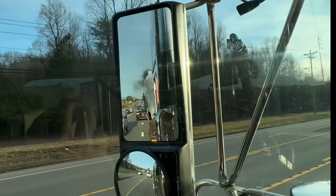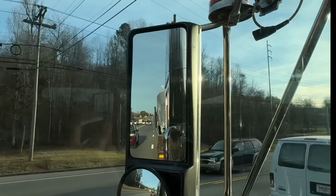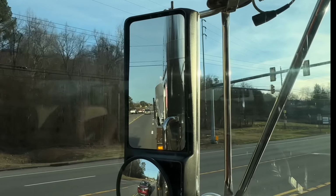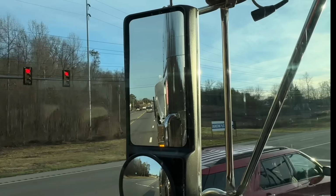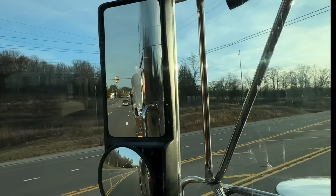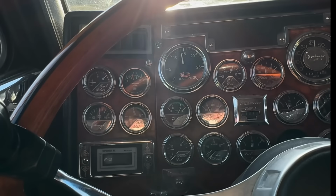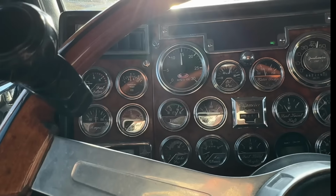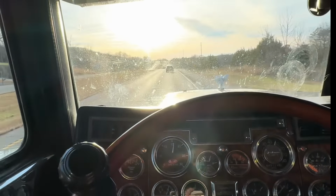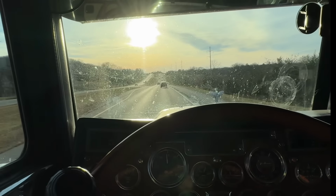So it's still put out in cloud if you want it to, but I can actually get into it and not black smoke now. Used to, I couldn't do this. It was just smoking. And I've not noticed a significant power difference either. I mean, it's still boost off boost you want it to boost. But on top end, it's not boosting near as much. That was my biggest issue.